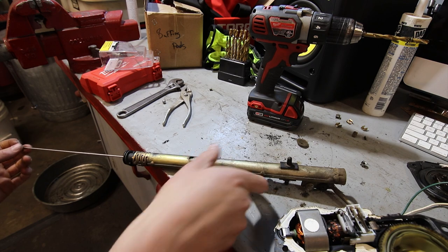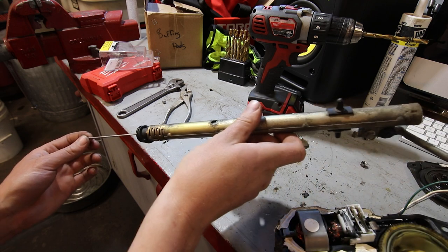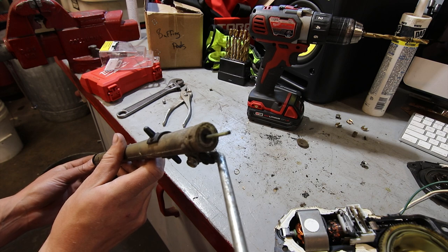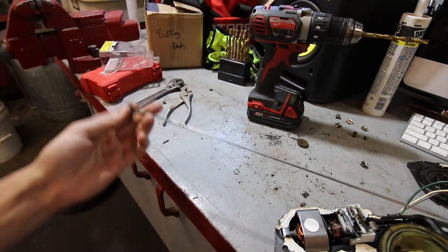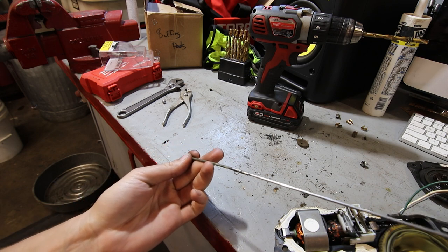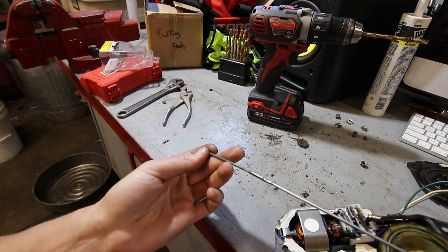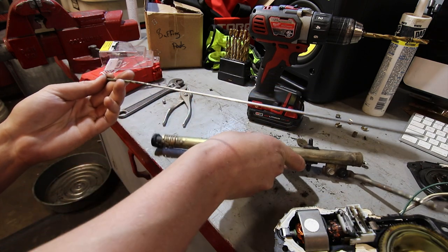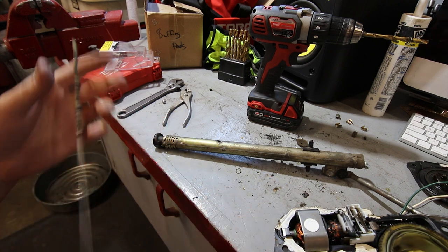And what you're going to find is that when you push it all the way back in, like so, on this end, you see the nylon cord come out. What you're gonna do is go shoop, pull that all the way out, and this is where we're gonna make our repair. So I'm gonna melt that nylon cord out, and take the correct size braided wire and solder it in there, or you can epoxy it. The guy that originally did this said that he welded his into place, but I probably won't do that because that'll be a little bit more labor intensive.